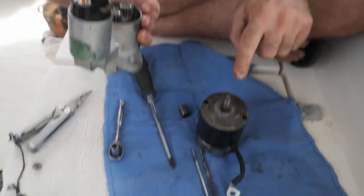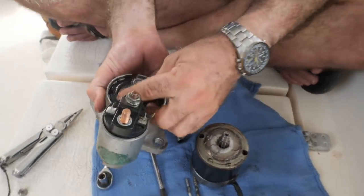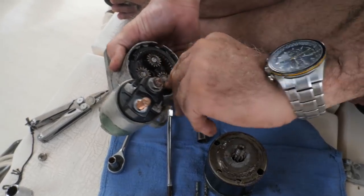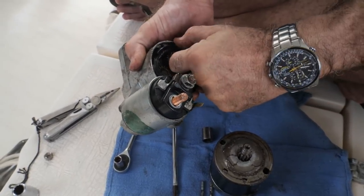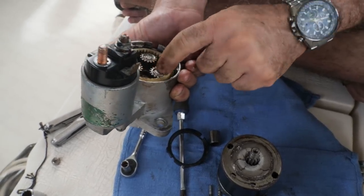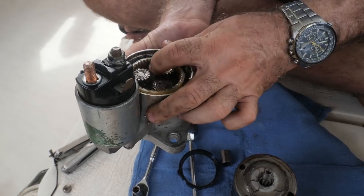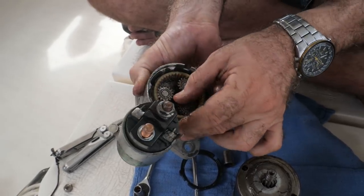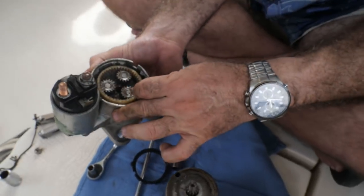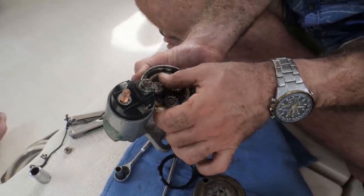What we have here is just your basic electric motor. On this side, we have planetary gears. The outer race gear of this planetary set is plastic - probably glass-reinforced nylon. It's a little shocking, but it's not worn away, so it's not our problem. This all moves nicely, so I'm going to assume this part's okay. We're going to look into the motor.